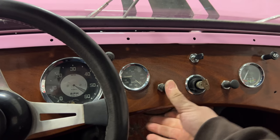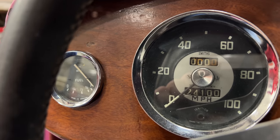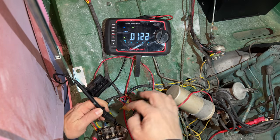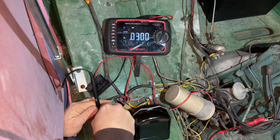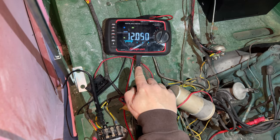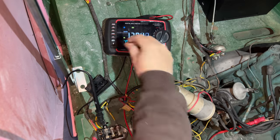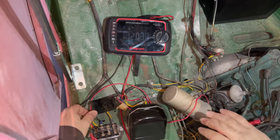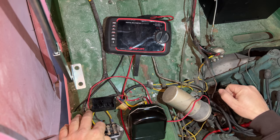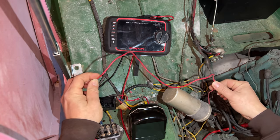The wipers are on — looks like we are getting switch power. The fuel gauge is working. Now I just need to verify that we have switch power over at the fuse block. We have full-time power on one side, and this side gets power when I turn the ignition key on — confirmed. So I can connect my wire from the coil to the fuse box. I noticed there's actually a black wire already running to the coil getting power from the fuse box, so this red wire was only used for hot-wiring within the engine bay. All I need to do is disconnect that and everything will work correctly.